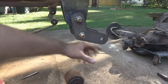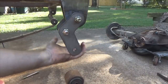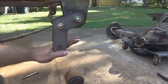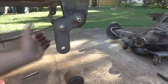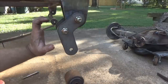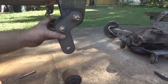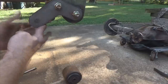This setup benefits full stuff but also full compression and full drop. When your axle goes into full downward articulation, the spring pulls the shackle outward and stretches it out. On a stock setup with straight shackles, if the shackle goes into full extension and the spring snaps back up quickly, it can stuff the shackle upward, catch the main leaf eye, and fold it forward — totally mutilating the spring. That's where boom shackles come in to prevent that.